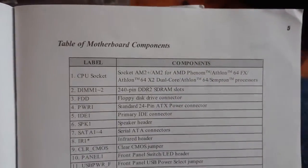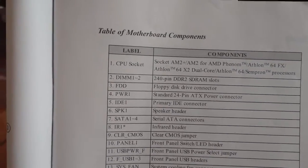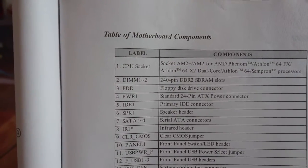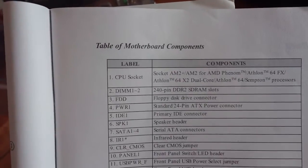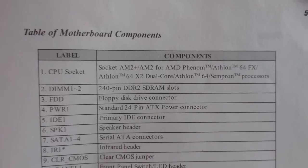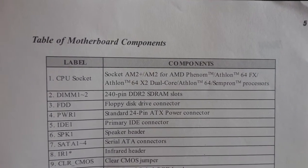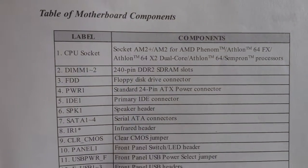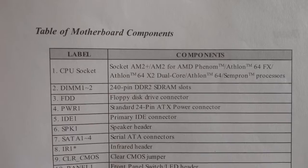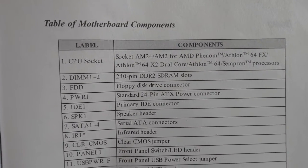One of the questions I had when upgrading processors — which is now old technology you can get on the cheap if you like to stay behind times on a budget — is purchasing an AM2 Phenom CPU. Right now I'm running an AMD Athlon 64 x2 that I purchased many years ago for around $132, dual core. My motherboard socket says AM2 Plus and AM2 for AMD Phenom and Athlon 64 processors. The processor I bought on eBay for about $32 is an AMD Phenom 2, and it's AM3/AM2 Plus. So because this is an AM2 Plus motherboard, will it fit an AM3/AM2 Plus CPU?